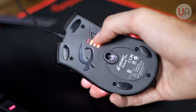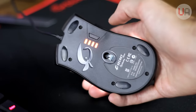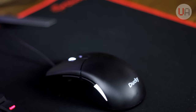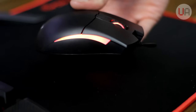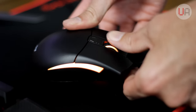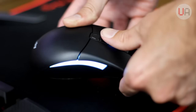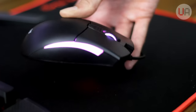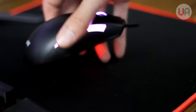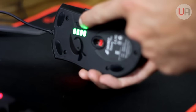The DPI is simply controlled by pressing the DPI button underneath. There are seven settings: 400, 800, 1200, 1600, 2400, 3200, and 5000 DPI. The RGB lighting is set to cycle by default, but can be set by holding down the DPI switch underneath and using the scroll wheel to reach the desired color. Ducky claims 16 million color RGB, but when scrolling through the colors it looked a lot more like only about 50 variants. The color cycle mode definitely looks to have smoother transitions.